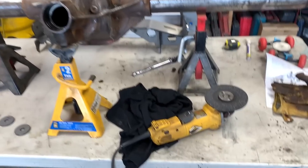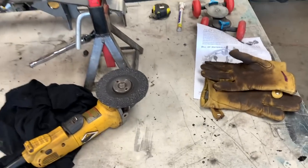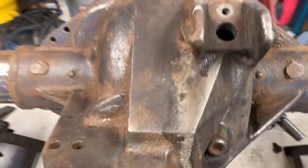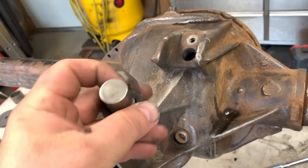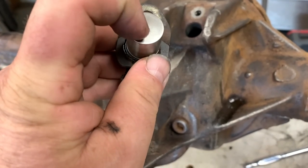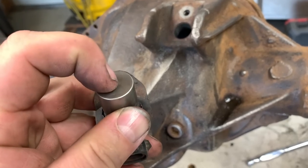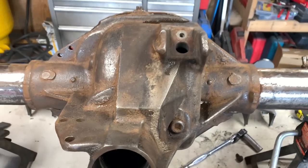I'm not going to film the grinding. You should never use a grinder without the guard in case the disc blows up — I don't have the guard anymore, but I'm going to wear proper PPE: gloves, face shield, and leather welding jacket. Pro tip number two: if you have a rear differential and your rear ABS sensor starts going bad and you remove it and it's all chewed up, something is seriously wrong inside your differential. The tone ring should never come in contact with the sensor, and if it's worn out, chunks of metal are going between the ring and wearing it out. Seen it happen, true story.